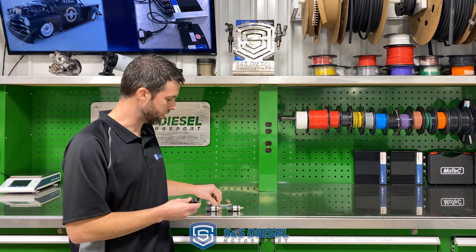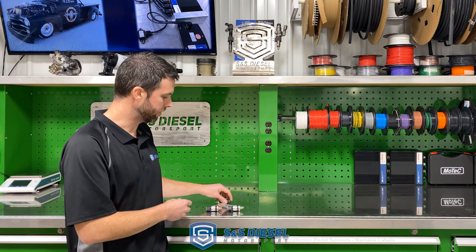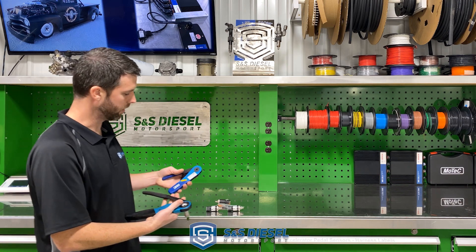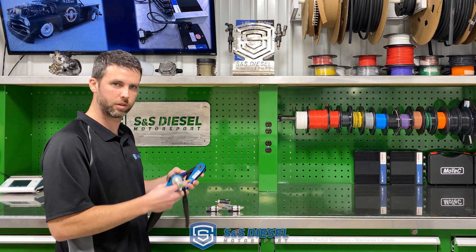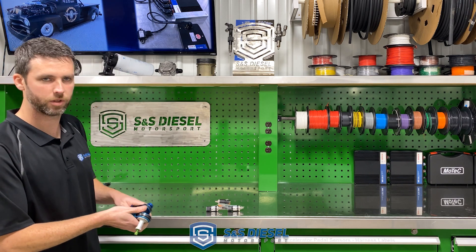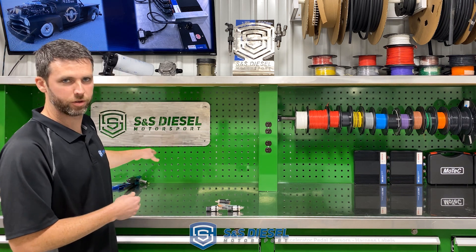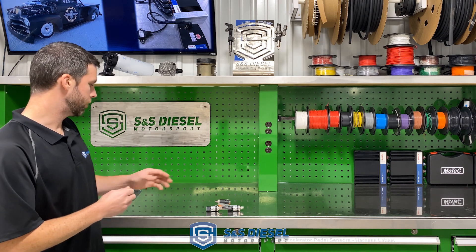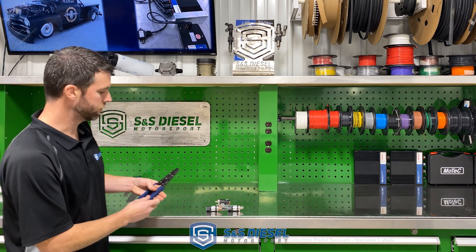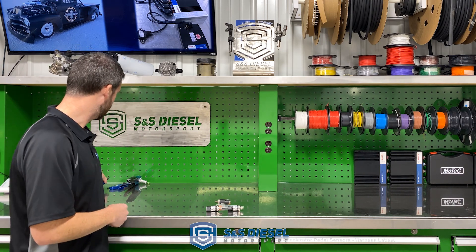With our kits, you can also order a connector kit. Typically on all of our stuff, we use these round style crimps — basically the crimp itself is round where the wire goes in. We have ratcheting crimpers which do a really good job of making awesome crimps quickly, but they're really expensive crimpers and we don't expect a lot of guys to have those. So we also have terminals with the normal automotive roll crimp style that you'd use with a more traditional style crimper. We've got both options available with these sensors.